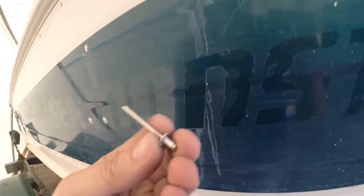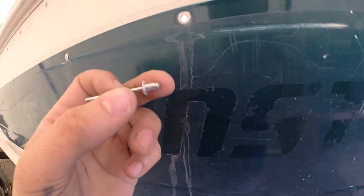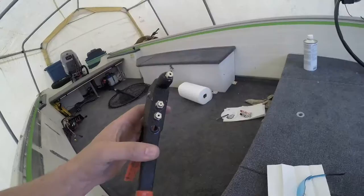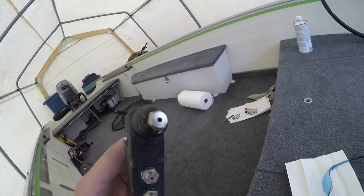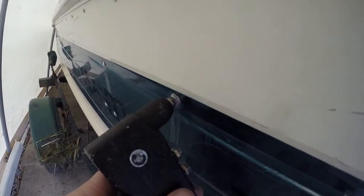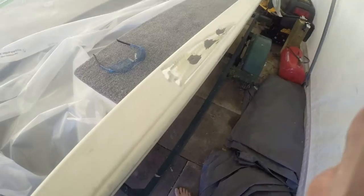I've got a couple left — I'll show you how to do it. Essentially, you put the rivet in like that, and as you use the tool, the ball pulls back, stretches out the backside, and locks it into place. This is the tool with the different size adapters — you pick the one that fits your rivet best. Just squeeze it a few times and that's it. The rivet goes into your hole and you squeeze the trigger.